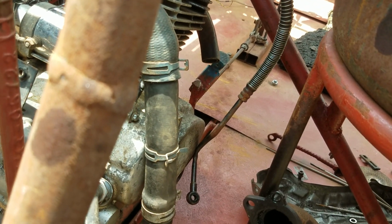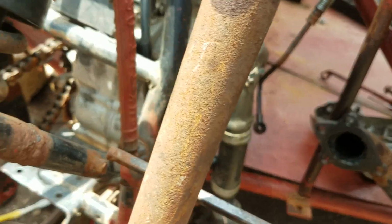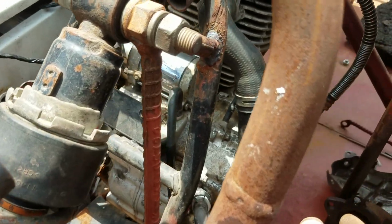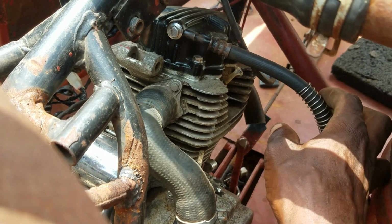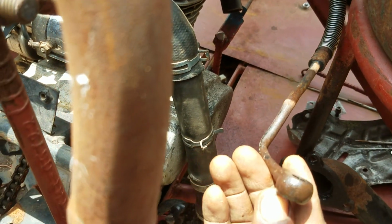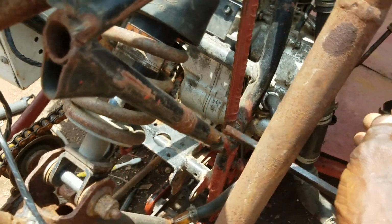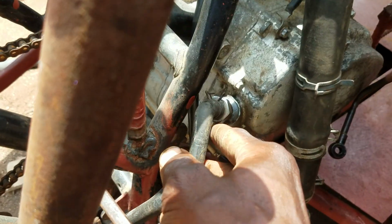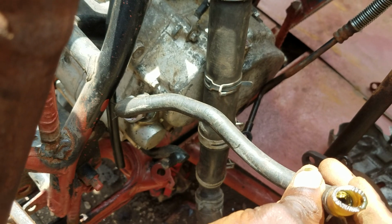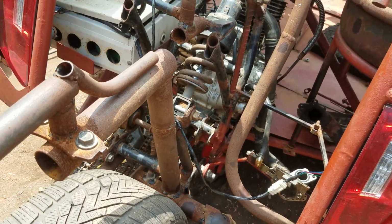So I cut it off, and the reason was because the turbocharger was actually down, and whenever I start up the engine, the oil flows from the top of the cylinder, which is this hose, flows from here and goes into the turbocharger through this particular hose. Now the return of the oil is actually down. It was meant to return from the oil gauge here. From the oil gauge, you can see the way I designed it to be. So it's meant to return through this hose from the oil gauge. But because it's down, it does not have something that we have to pressurize it to come up.